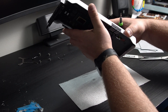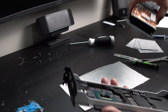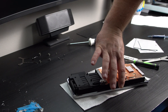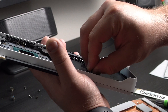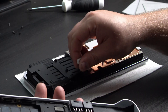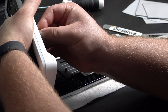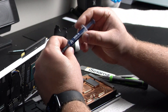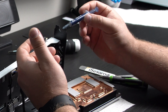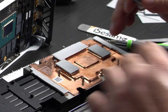The back plate is back on. Now we're ready to put this heatsink back on the PCB. Let's connect this little RGB thing right in there, and then connect this one to this side. Now we cannot forget the thermal paste — I'm using MX-4, you can use whatever you want. I'm going to put an X pattern so that when I compress them together it'll spread nicely.